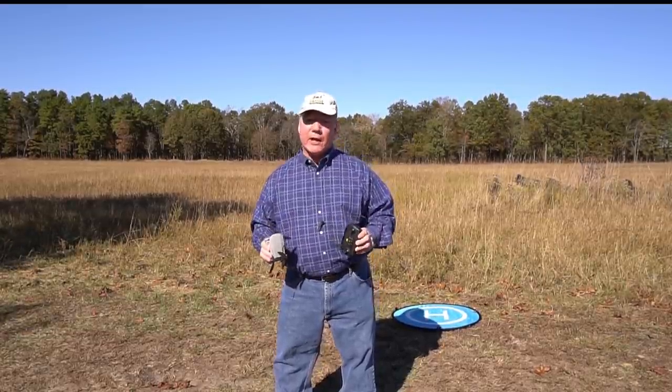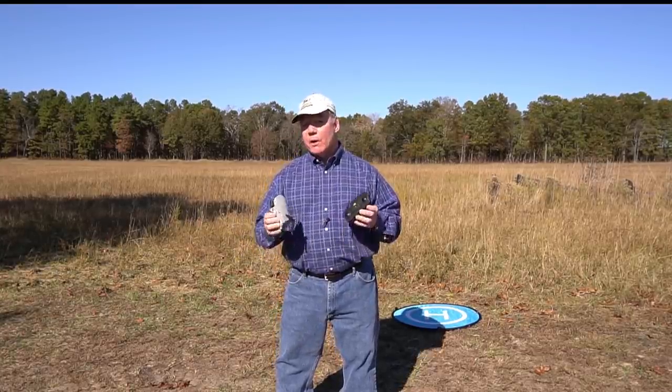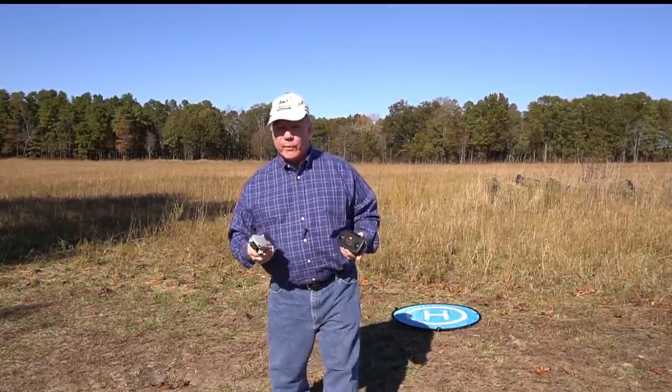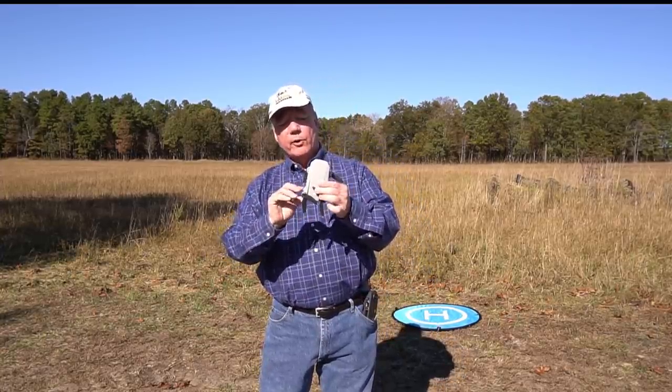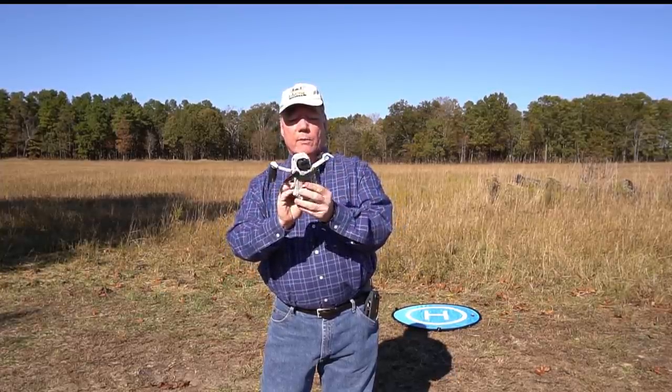Now I know experienced flyers have their own pre-flight checklist, and you're probably going to do exactly what you do with other drones, but there are a lot of new flyers that are going to fly the Mavic Mini for the first time. I just wanted to walk through what you need to do to get it started. So I'll start with the drone, and basically the drone is in its folded position right now. And to unfold the arms, you'll start with the top arms and fold those out. Then you'll go to the bottom arms and hold the body, and you'll spin those down, just like that.